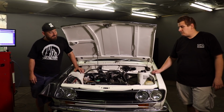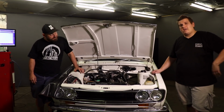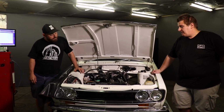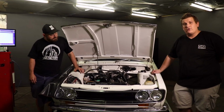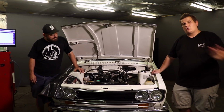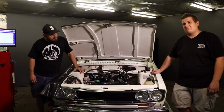So now what, Timmy? Next for this car, I think we'll be putting some road Ks on it. Mick plans to get out there and do a lot more driving with it. As shown on the dyno tuning, the mid-range drivability and the throttle response is well improved. He's got better air fuel ratios across the board, so his fuel consumption is going to be a lot better. The engine's working more efficiently compared to how it was before.